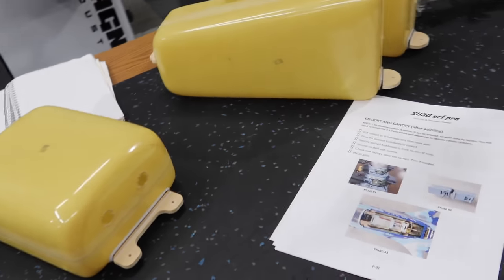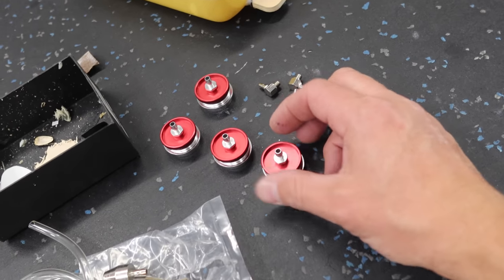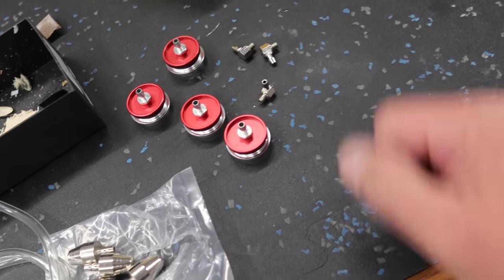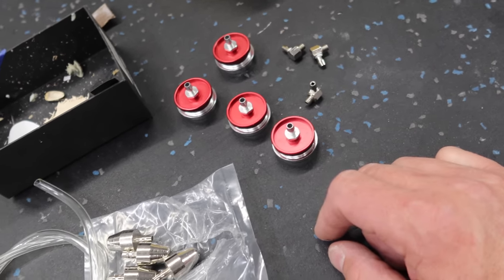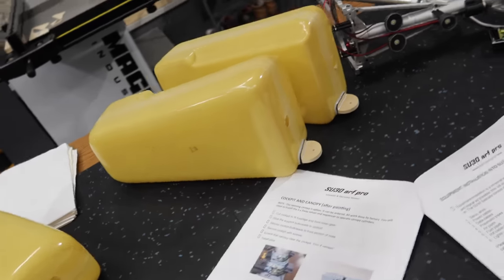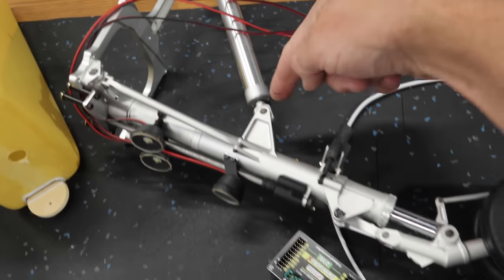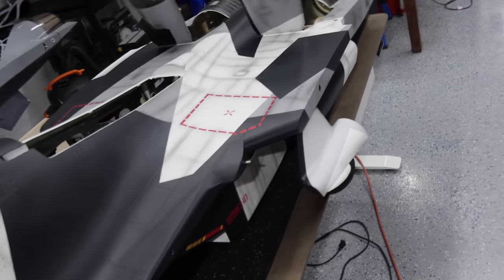In the unboxing I was very excited about the included aluminum fittings — but I got too excited for no reason. These are all six-millimeter Festo tubing size, which is not good. We want to be using eight-millimeter on everything. The eight-millimeter fits over the six-millimeter but very loosely, and even with tie wire it's not safe. So I'm ordering new vent fittings and tank fittings and we'll be doing high-flow on all tanks. We did get the front gear out — very simple once you undo the bolts and cut the airlines.